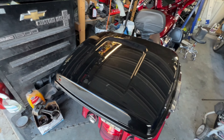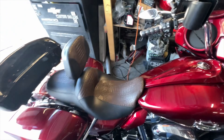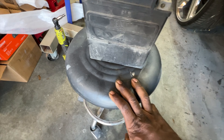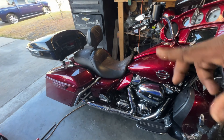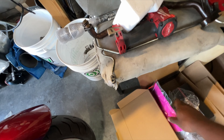This is where it's supposed to be. One more time for the camera — key power on. It went up to 12, 13. See where it dropped during the cranks — never went below 12. That's good.